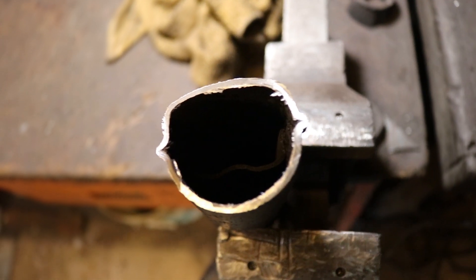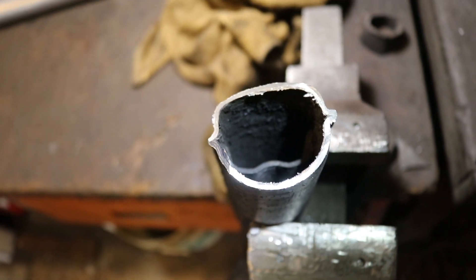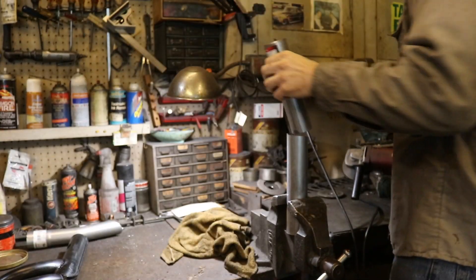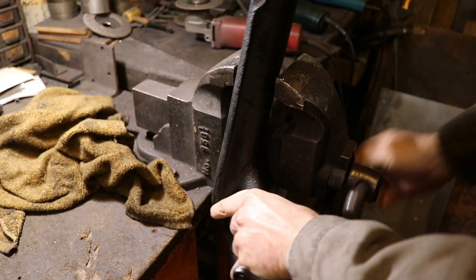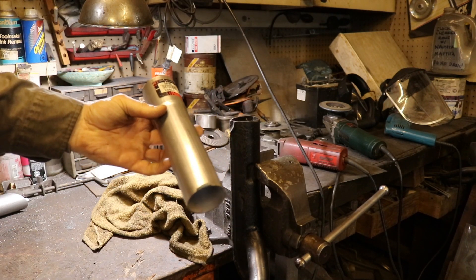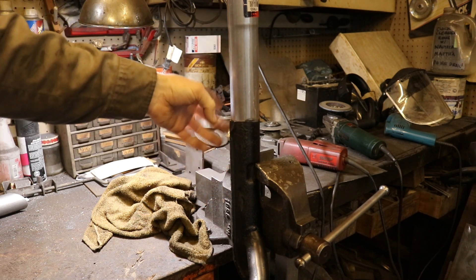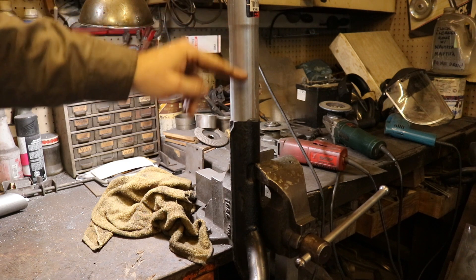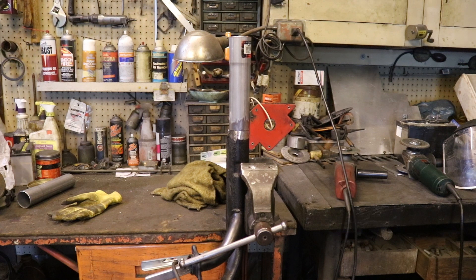Here's my pipe opening now — you can see the baffle is still down in there a few inches, which is what we want. I've cut the resonator pipe in half, so I no longer have the flare end. Now I can work with just the two-inch part. I'm thinking I'll weld that straight onto the end here — they're basically the same size — then figure out how far back we want it, cut it, stick the other part on, and figure out where the clamps go.